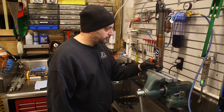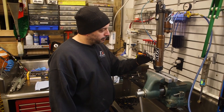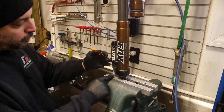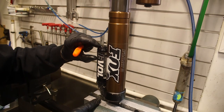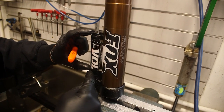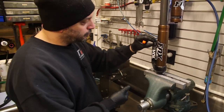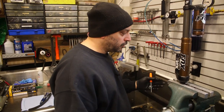If you do not do that, what happens is that floating piston - if the main chamber only has 30 pounds and you go to put 50 here, this will move up. And when you set 150 it's only going to be in there. Or if you discharge, the floating piston moves to the bottom and now when you put 150 it fills that up. You need the air volume in order to make the progressive spring rate in this air system work correctly. If you do not, the whole ride is off and you'll be chasing your tail.